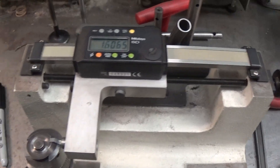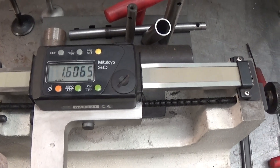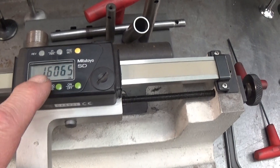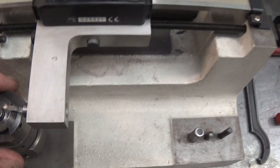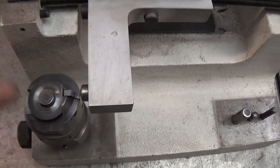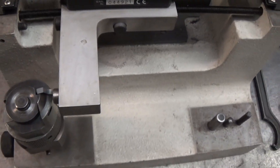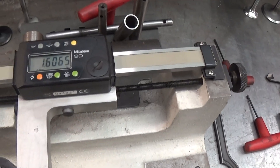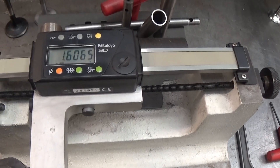It takes the guesswork out of setting the seat cutter. Our valve is inch and five-eighths, it measures like inch 626. I've set the machine at inch 606, which gives me a 20-thousandths margin. You just adjust the tool out until it just touches — this is a spring-loaded pad here. When that tool just touches that, the OD of the 45 will be 606, 6065, which will leave a ten-thousandths margin.